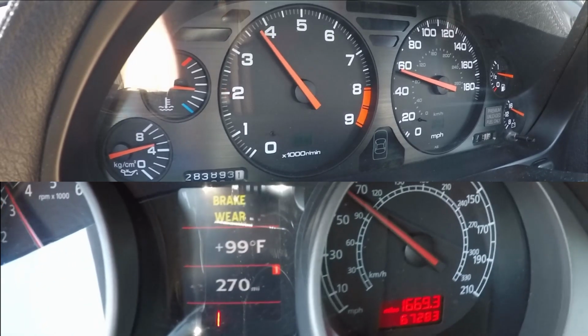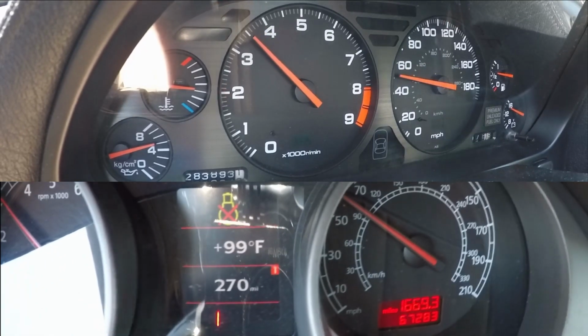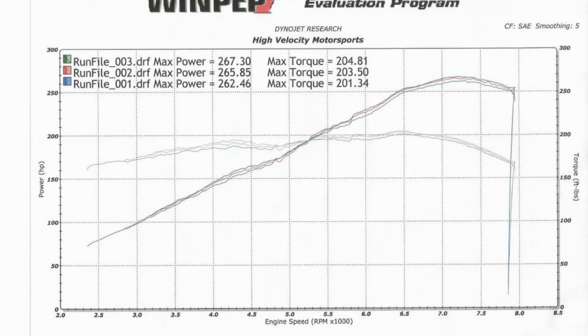Bet you weren't expecting that, and neither would I, frankly, based on these cars' stats. Here, for instance, is a dyno graph of my actual NSX. This might even be a touch optimistic, as I've put cats back on the exhaust since, but it should still be close. At 3,500 RPM, I could expect to have around a 1.5 liter Miata of horsepower and around 180 pound-feet of torque available at the wheels. This is enough to shift the sub 3,000 pound NSX along just fine.